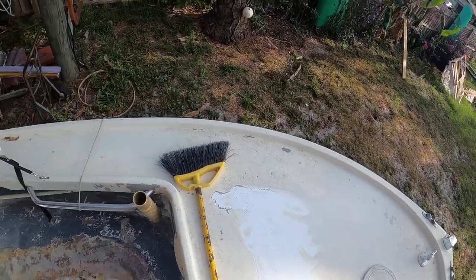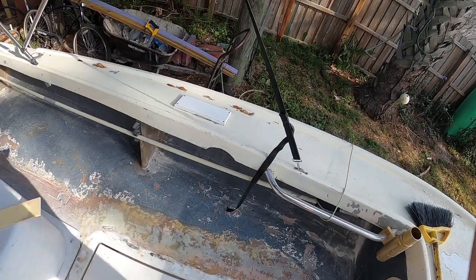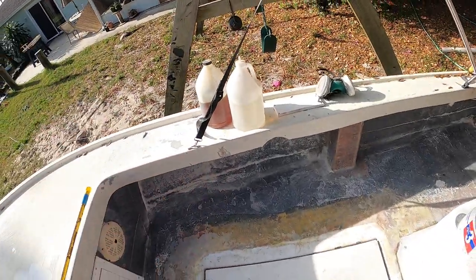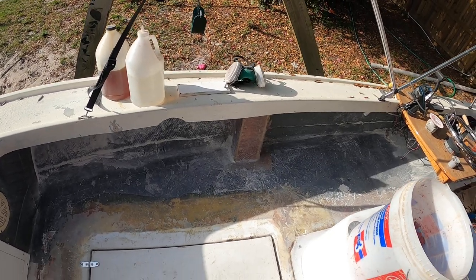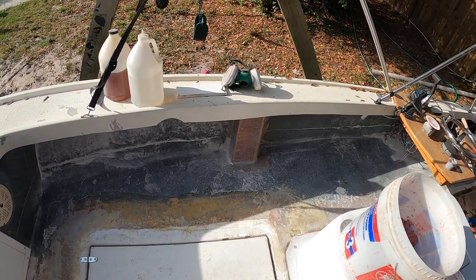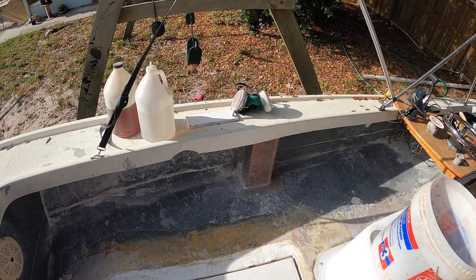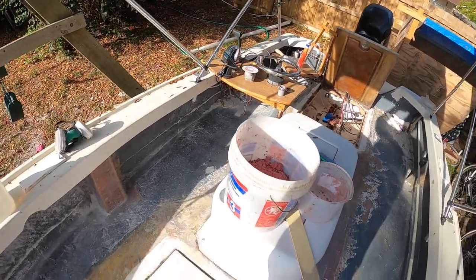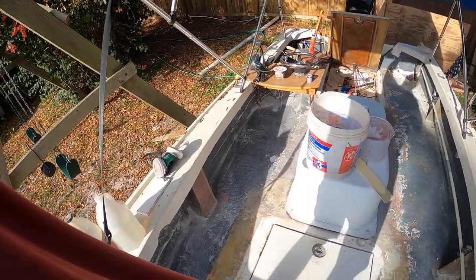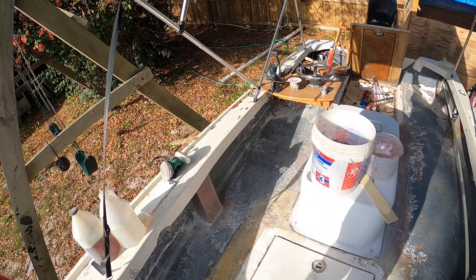You can see the freeboard where the speakers were cut out — the half moon shape on the port and starboard side. My chase for the lines going down into the tank sender and whatever else I may need — bow light, speaker wire — hides up underneath the gunnel and runs up underneath the console.